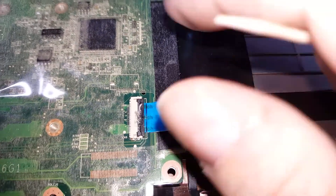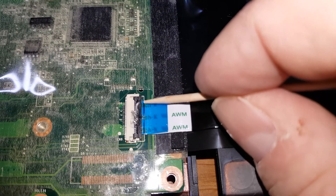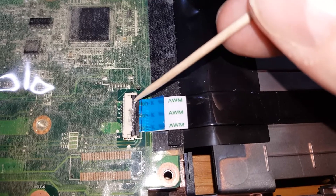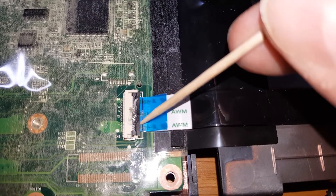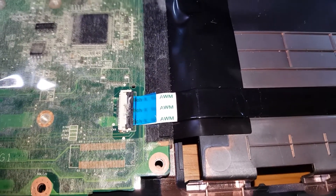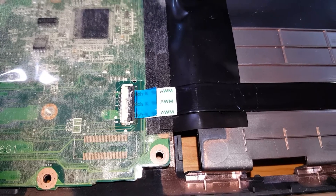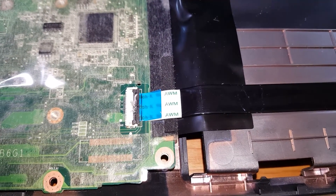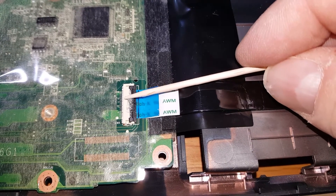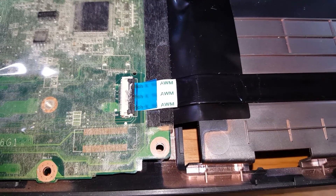We've got ribbon cables that need to be reconnected on the motherboard, and these little clips sometimes break because sometimes we have huge fingernails or toothpicks that we try and open these clips up with. So what I'm doing is I've got the ribbon cable in there, I've got the clip in place, and just a tiny dab of hot glue to hold everything down — I'd hate for it to slip out or not be a tight connection. Leave a comment as to what you think about doing this with a little bit of hot glue. It kind of makes it look like a cheap piece of throwaway electronics, but I think it serves a purpose.